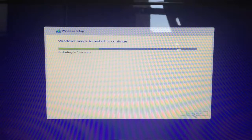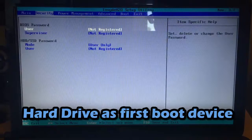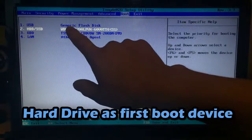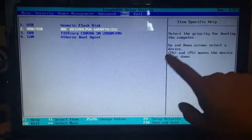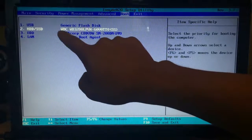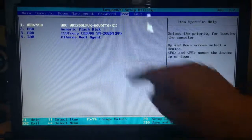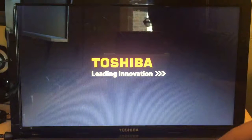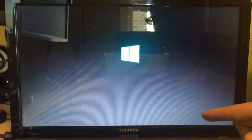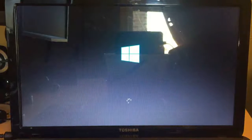The computer is going to restart at this point. When you hit your manufacturer's splash page, go back into the BIOS — I'm pressing F2. Now we're going to change the boot order again. This time, instead of booting from the USB, we want to boot from the actual hard drive. I'll use F5 and F6 to move my Western Digital hard drive back to first place, then go to Exit Saving Changes. Now the computer should boot into Windows 10 from the hard drive.